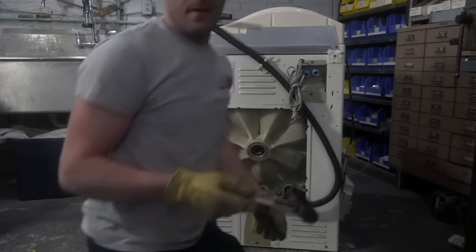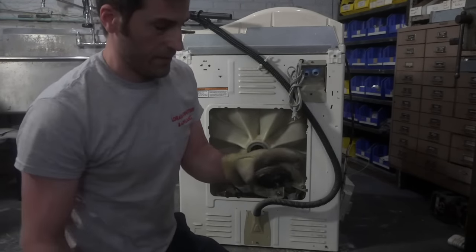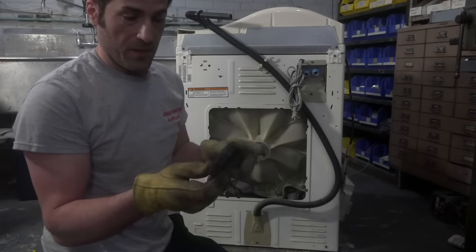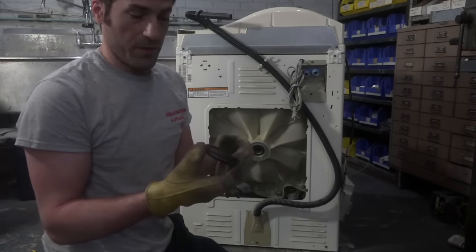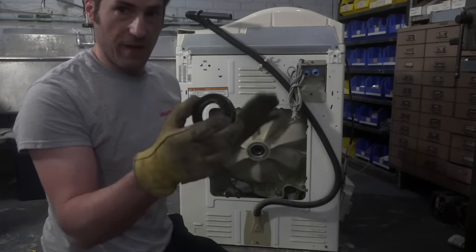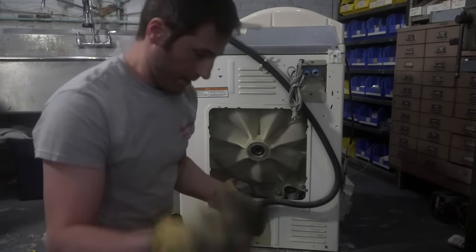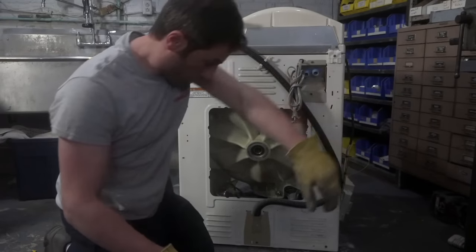So it's really important when you take the seal out, don't immediately throw it away. The Neptune kit, the seal kit, comes with two separate seals. One is for the early version, and the other one is for the updated version, which this one is. This is the revised one, they call. You're going to match them up, so don't throw it away. Otherwise, you're not going to remember, and you might inadvertently install the wrong one.